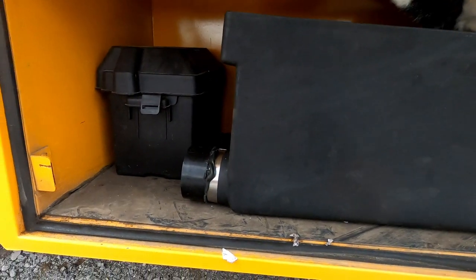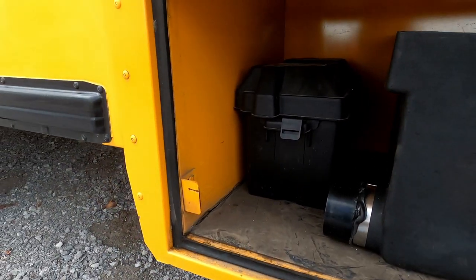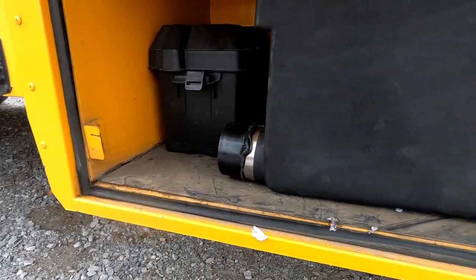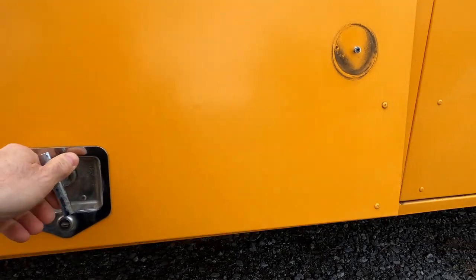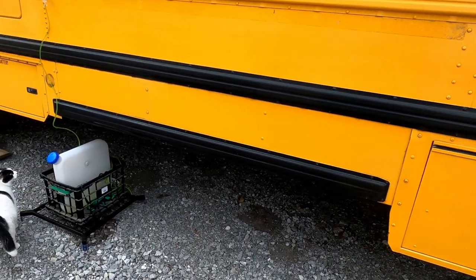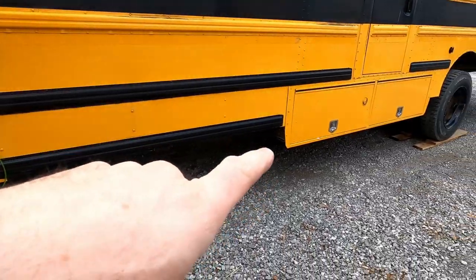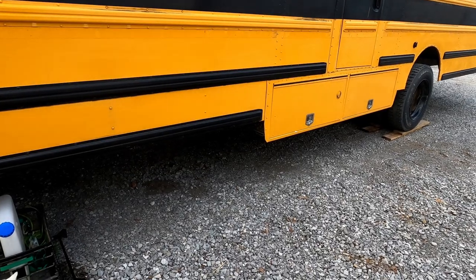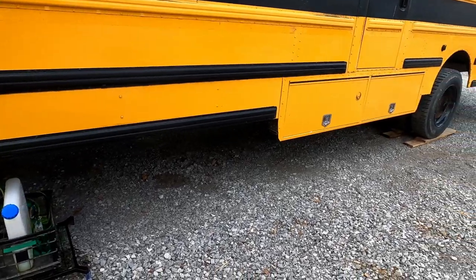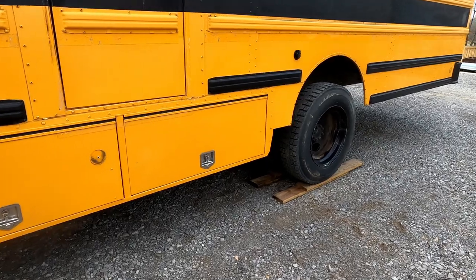Anyway, I'll have to get the plumbing to come out through this sidewall right here. I'm trying to do this one-handed, but the tanks are going to have to be tied together to a drain valve where they'll be able to hook to the sewer and, you know, be drained out when needed. I do have to add a tank monitoring system to the tanks then too, so that I can tell when they're full and know if I have to do emptying on those prior to a person's checkout. Just depends on how much usage there is.